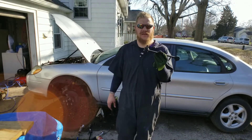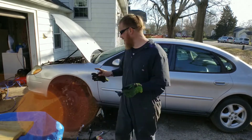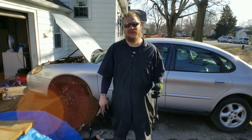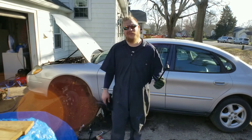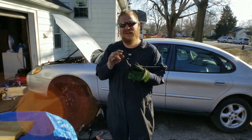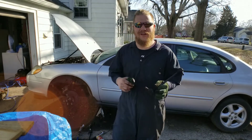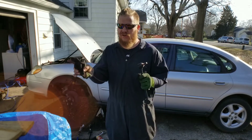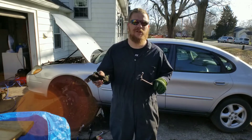The passenger side came out real easy — it's a 17mm. I don't know why it's an 18mm on the driver's side, but it didn't want to come out easy, so I went ahead and cut it out. Now we're going to replace it with the new one, and the passenger side gets its new one as well. Remember, it's 17mm and it's reverse thread — you'll have to unscrew it going to the right and not the left, so don't be tightening it when you're supposed to be loosening it.